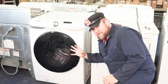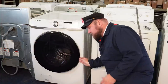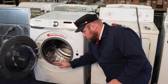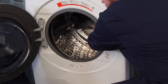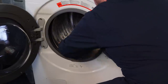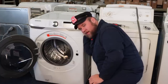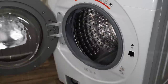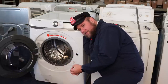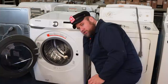Let's do some tests that may be a little exclusive to front loaders. Front loaders are generally going to be the same between different makes and models. The big thing I always look for is to open the door and give the tub a spin, much like a top loader. We just want to spin the tub and see what we hear. Oh, that does not sound good at all — it sounds like someone may have tried to wash concrete in it. So if you ever hear anything like that on the inside of the tub when buying it used, it's definitely something to fail the washing machine on already.